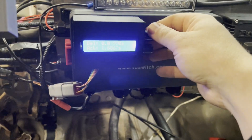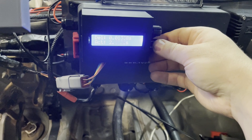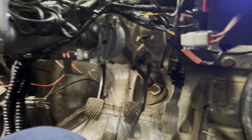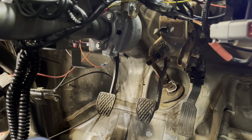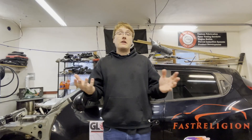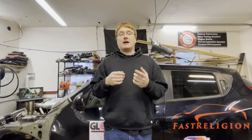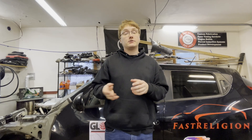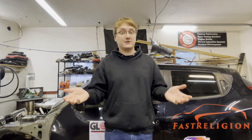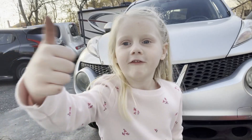Let me show this again — turn the delay way down so it's almost instant, and turn the activation time way up so it holds for a long time. Two step, clutch, release — just like that. Thanks for watching. This is an informational video about clutch slippers, but if you want to buy one, let me know. I hope this told you everything you need to know about clutch slippers, and if you didn't know this sort of thing existed, now you do. If you were struggling at the racetrack, now you know there's a solution. Like and subscribe!